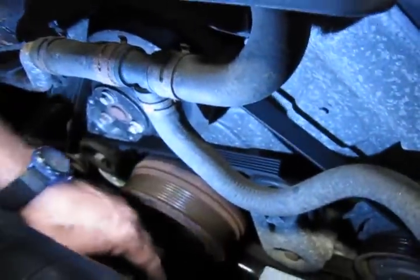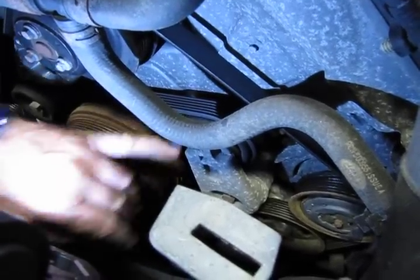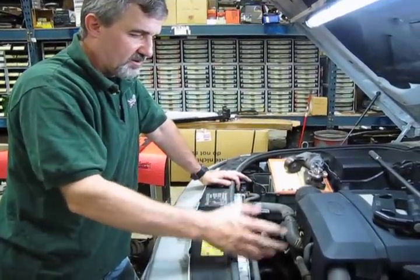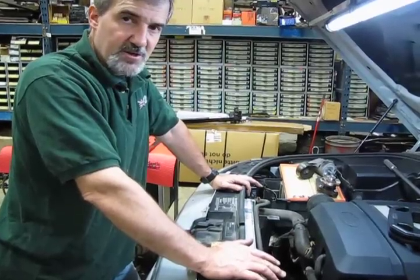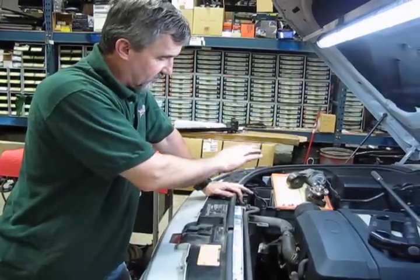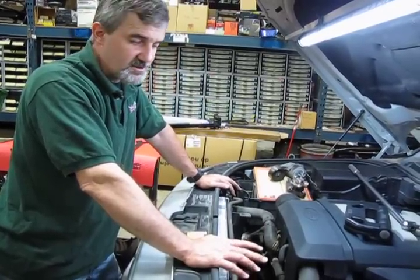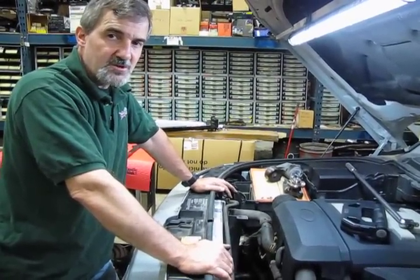To remove that belt we're going to use a three-eighths-inch breaker bar with a short extension to get past these hoses, release the tension, and slide the belt off this pulley. That will relieve all the tension off the alternator and then we can remove the belt fully. Once the belt is out, check your pulleys, then put your new belt back in using the routing reference you made. Reassemble just the opposite of how we took it apart — re-bolt the bracket, put your tensioner on, your front belt, and the shroud pops right back into place. When you're ready to change the belts on your 4.4 AJ engine LR3 — covering '05 through '09 — give our knowledgeable salesmen a call at 1-800-533-2210. Thanks for watching.